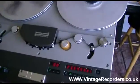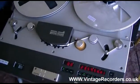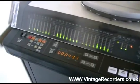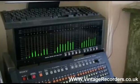I queue up the Mitsubishi. On digital tape, you don't really want to use the beginning because there's usually a lot of errors there. You set the counter, put this machine into record, and press play. A little green flashing light at the top represents what's called a CRC error, or cyclic redundancy check.